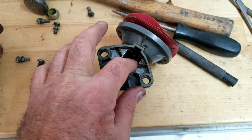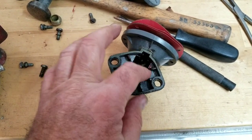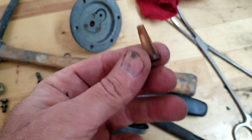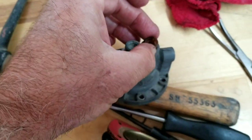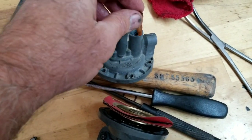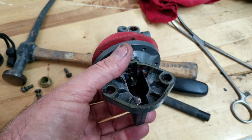You don't want this to wear out because there is no lubricant in this part of the fuel pump. Get your acid brush with grease and grease everything up really good before you assemble it. Your filter actually fits in here - it goes down in here, there's a little nut here, and that has your filter - kind of a screen - inside there. So there is a filter if you're wondering about that on a 36 horsepower pump.